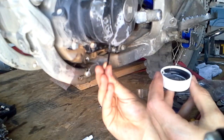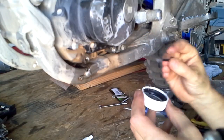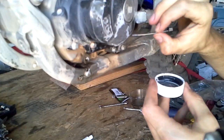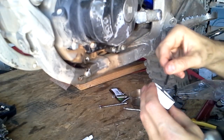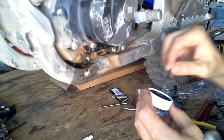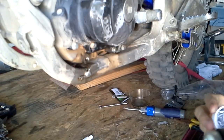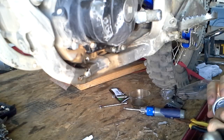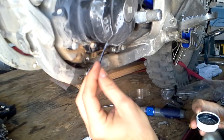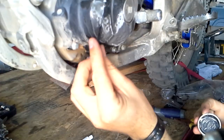You have to let it dry for about 20 minutes and you can actually start the bike after that, but I'm going to leave it 24 hours to cure properly. I only had a little hole here in the middle but I'm just gonna JB weld the entire thing - give it a little more mass in case next time I drop it, it might save the case. In the meanwhile I can do my oil change and all the things I need to do. This six dollars saved me from buying a new side case.